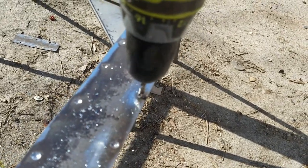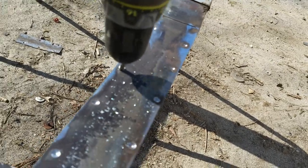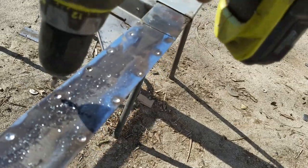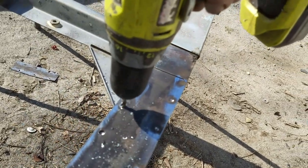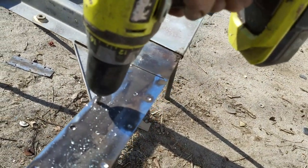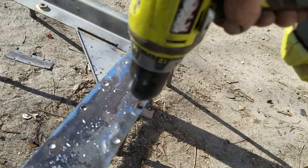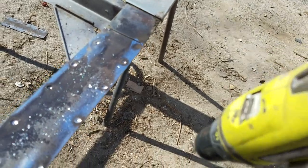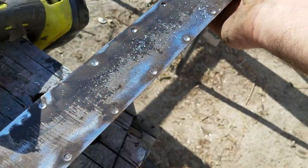Drilling out the spot welds, you choose a drill that's the same diameter as the spot welds, usually 3/16, about 4 millimeters, and you grind that drill so it's got less of a point than normal. That helps it to not drill through the second skin, and it just removes the spot weld.